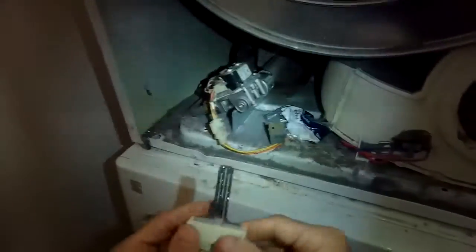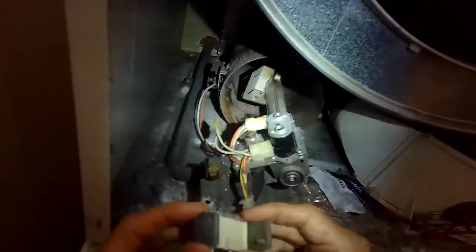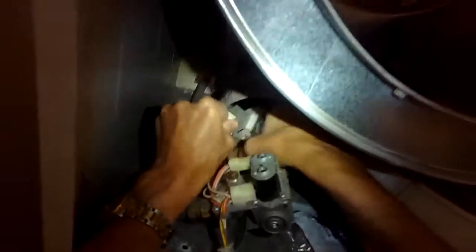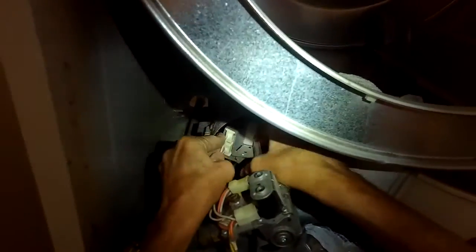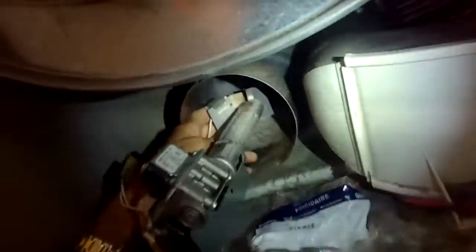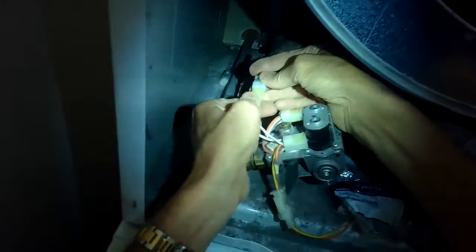We tested the high limit and that worked. We tested the igniter and it showed it was bad, so we'll go ahead and replace it. I'm going to put the old spring clip on the new igniter and put it back on the metal plate. I'm going to slide it back on — be careful not to bang that shiny igniter against any metal pieces because it's really fragile. I push in and wiggle with my fingers to get the spring clip up over that metal bracket. Got it in there. Now I can go ahead and connect the power coming to the igniter, making sure I get it seated as far together as it can go.